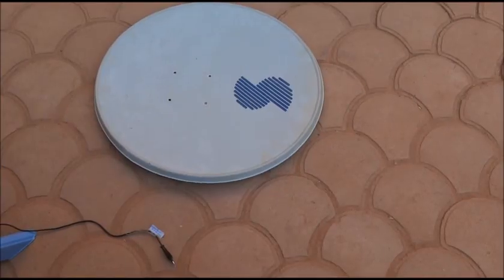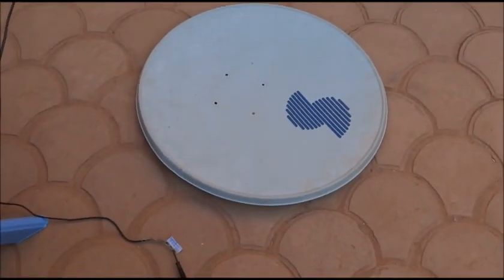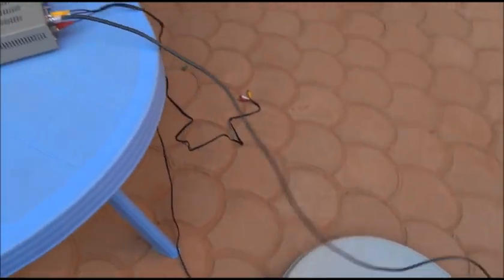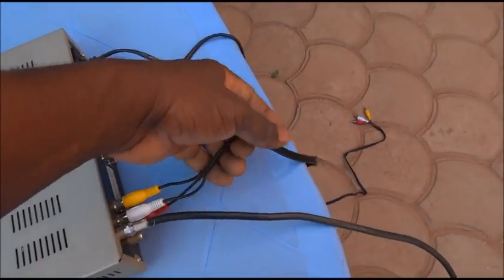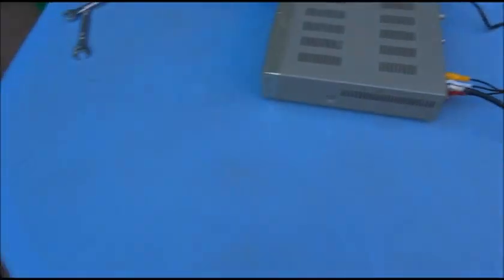What are the main components? To summarize: the signal is sent from somewhere in the sky, sent to the satellite dish, and the dish will concentrate the signal. The signal is then collected by the LNB, and the LNB will send it to the decoder or satellite receiver. From the decoder, the signal is decoded and you get the picture, movies, and music to your TV — either by an audio-video cable, HDMI cable, or other types of cables.